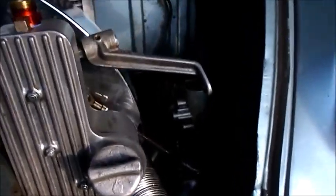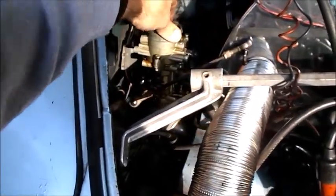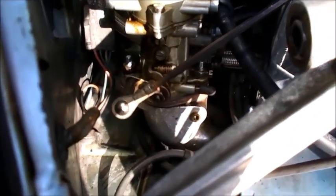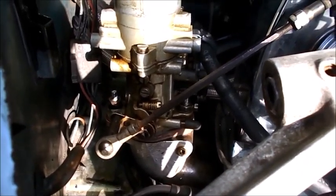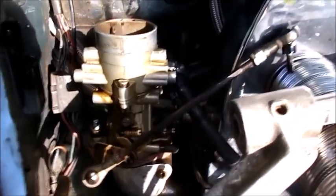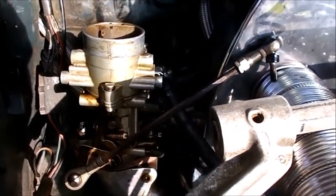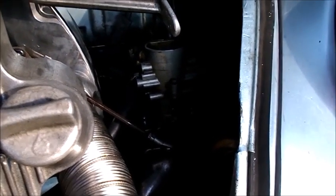Alright, I got everything bolted in. I think I'm ready to attempt to get it idling again. For whatever reason, I don't know why, this carburetor over here was dripping gas when I got back from that last mileage run. Couldn't find anything wrong with it. Anyway, I went into my gasket kit and replaced the pump diaphragms. The other ones were old, they hadn't failed, but I figured, hey, since I had them apart, might as well put the new diaphragms in.